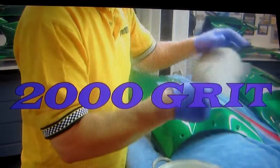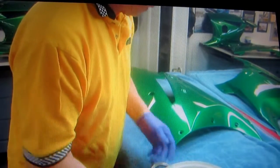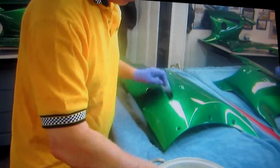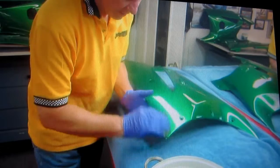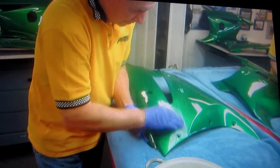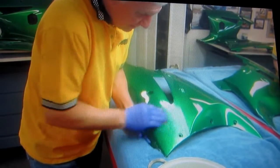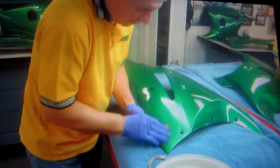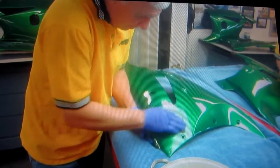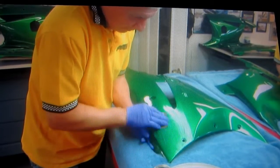See, now here's a good case. Back then we were using 2000 grit, and it was a lot more work buffing things out. We've upgraded that to what we have on this restoration, to a 2500 grit and a better grade of 5-star clear. I just think that's the kind of information that's worth sharing. Anyway, we're going to get back to work. Enough with the nostalgia, the coffee, the memories. We have to move on this FZR restoration.